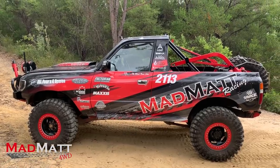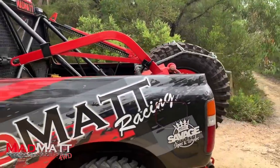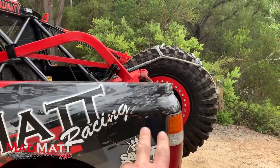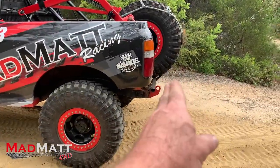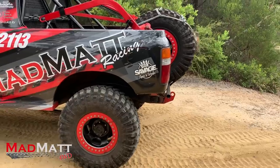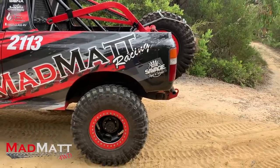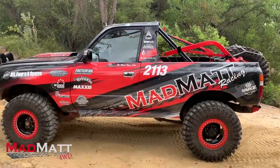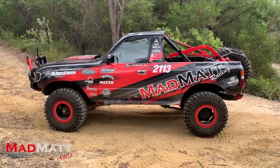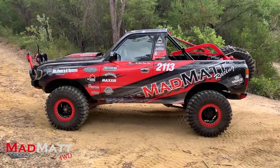So I wanted to make my race car look like that. Some mates and I basically chopped the back part of the roof off. We also bobbed it, which is where we removed about 250 millimetres from this section of the body and the chassis, which meant that we shortened up the chassis rail and the body so we can really get that departure angle nice. We also cut the rear quarters down — did that quarter chop — and that just helps have clearance at the back of the vehicle. The proportions are correct and I absolutely love the look.